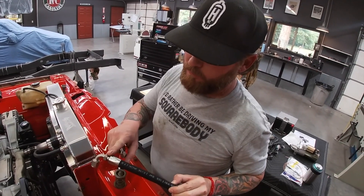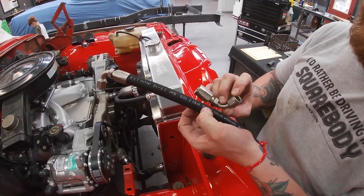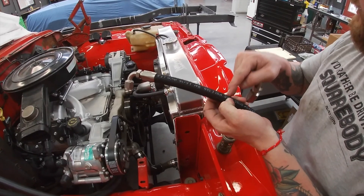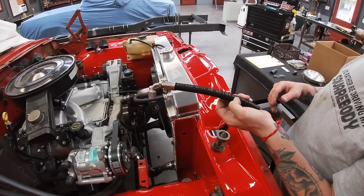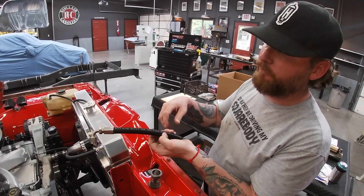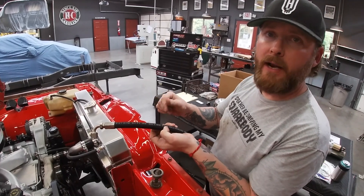I mock up the fitting and pre-terminate one end so that when I go to put them together, it's easy to line it up and see where to cut. I made a mental note to cut between the zero and the five there — that hose is going to max out right about there in the fitting. To cut these, I use a band saw. Another way is a chop saw with a three-inch cutoff wheel. Don't use scissors or regular cutters — you could use hydraulic cutters, but the easiest I've found is the band saw or cutoff wheel. Make sure you rinse the inside out and blow it out with an air gun — you don't want little fragments of rubber inside.